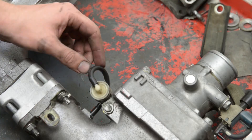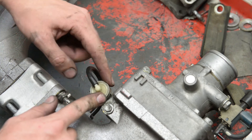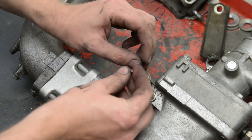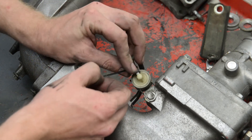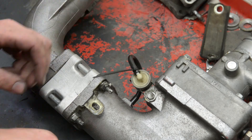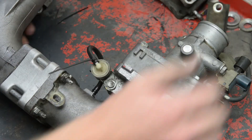There is a little trick we can do — the owner of the car said that this hose was popping off all the time. So what we can do is just put a little zip tie here on the other one; it'll just grip it enough until he has time to grab a new one of these filters. That will keep things going for a little while. Throw that on — that should help give just enough friction so it's less likely to pop off on you.